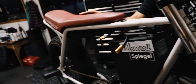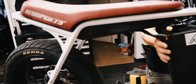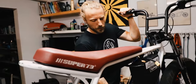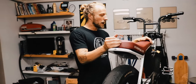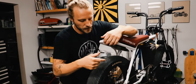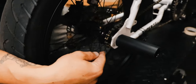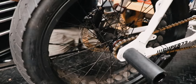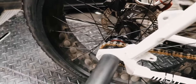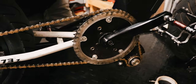The controller does 40 amps, the battery is 72 volts, and fully charged it's about 84 volts — so we'll actually get close to 3000 watts and hopefully hit 45 miles an hour. For the gearing ratio, in the back we're running a 16 tooth sprocket, and we do have a 14 tooth sprocket that we might switch out if we think the ratio will be better to hit a little bit more top speed. In the front we have a 46 tooth sprocket.